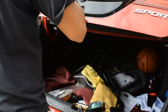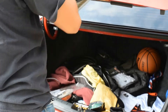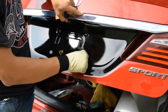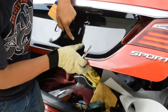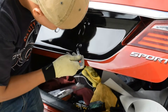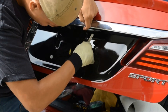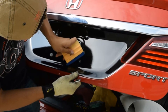For this part I'm about to start cutting the little circles where you put the screw in for the license plate. Use your squeegee to push it in as much as you can, and then — you're not going to cut on the paint but cut on the little plastic piece where the screw goes — make a little circle around it and remove the rest that's on top. You'll see me pop off that little remainder once I'm done tucking it in.